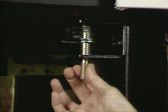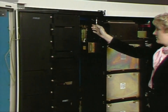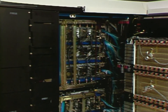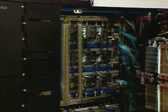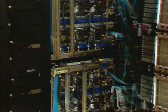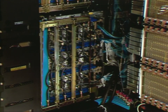Gate latches can be locked by screwing them into the frame. It may be necessary to turn the latch in order to unlock it. Releasing the gate latch and opening the gate gives you access to the two TCM boards containing the 3090's processors. The upper TCM board is the D-gate and contains Central Processor 1. The lower gate is the E-gate and contains Central Processor 2. Both TCM boards are removed from the frame from the rear.